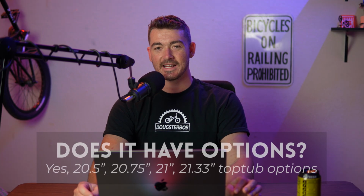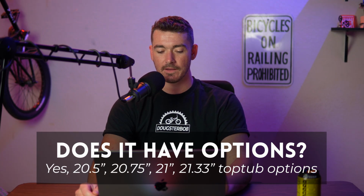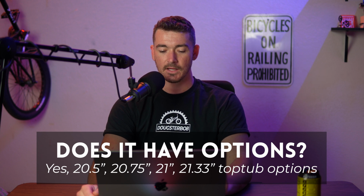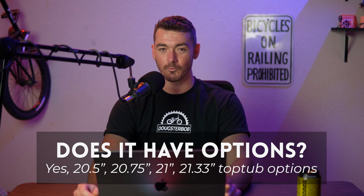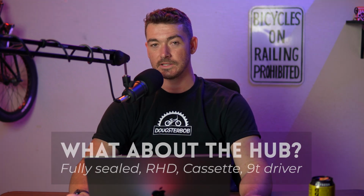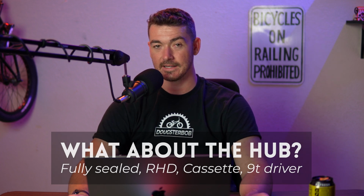So the options that it has, there's a lot of different options. I'm just going to read them. It comes in a 20.5 inch matte trans purple, a 20.75 matte trans teal, a 21 inch black, a 21 inch matte trans red, and a 21.33 matte raw. There's a ton of options there. That is a lot of options. The hub is a fully sealed cassette with a 9-tooth driver, meaning the bike has a 25/9 gearing system.